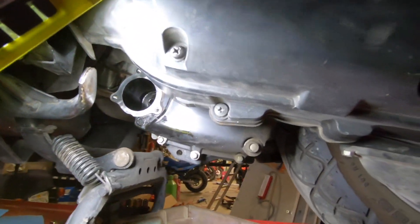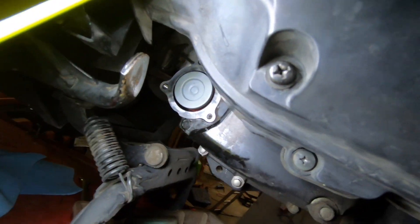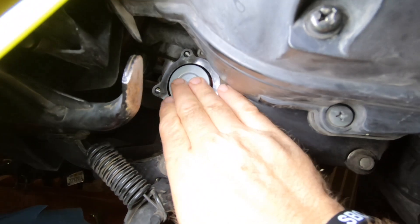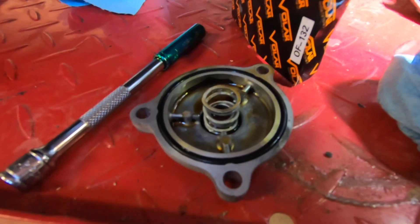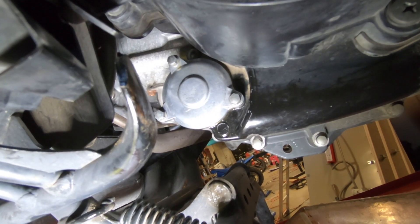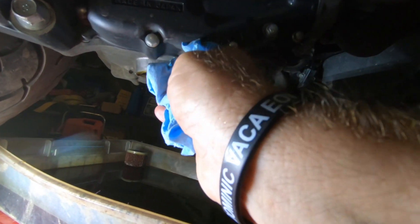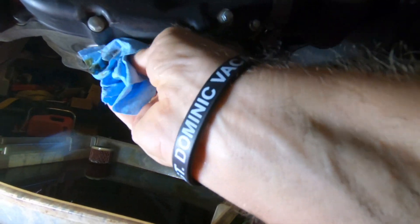Now that the cavity is wiped out, we're going to put the new filter in. It goes in like so — make sure it's snug and seated. Now we're putting everything back in reverse order. Clean the cover, inspect the o-ring; if you need a new o-ring, get one, but mine's good so I'm putting it back the way I found it. Now that the filter cover is reattached, we can clean it up, wipe it all down, and then move to the right hand side to replace the oil screen and drain cap. Use some WD-40 on a rag to wipe it all down and get rid of residual dirt and grease from the underside of the bike.